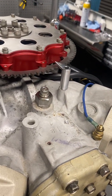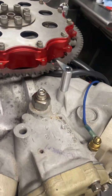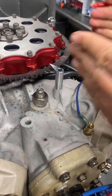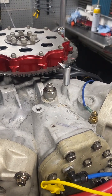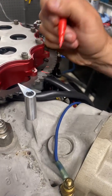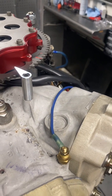So we're there. We're going to take a marker that comes in the kit and make a little dot. It's sometimes easier to make your mark and then rotate it around to get yourself a good mark. The further out you are from the center, the more accurate it becomes — the one degree spread is 30% greater — so you always want to mark on the ring gear. You also have the option of putting a cylinder number beside it.